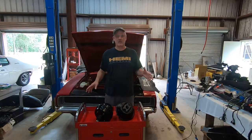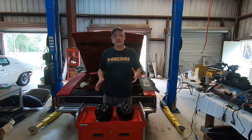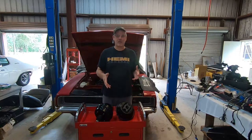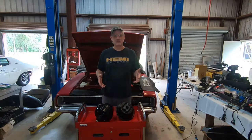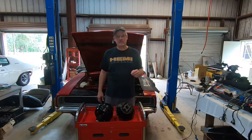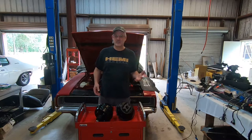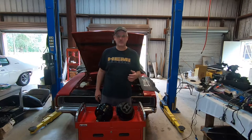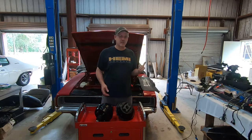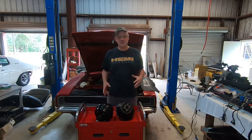But I soon found out that the brakes just didn't work as well as they should have. I didn't have the stopping power — they just didn't bind up and lock like they should. I had plenty of brake vacuum, but it just didn't work. When I did a vacuum check, because of the camshaft I chose, I was only running about 12 inches of vacuum, which isn't a whole lot. I even went as far as installing a secondary vacuum booster, drawing 22 inches of vacuum at the booster, and the brakes still were not working good. I was just not very happy with it.